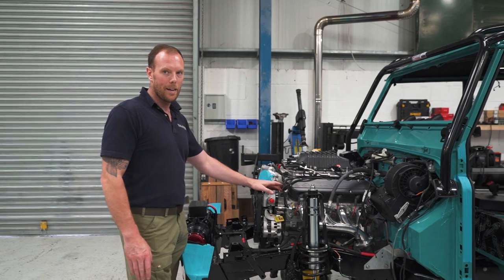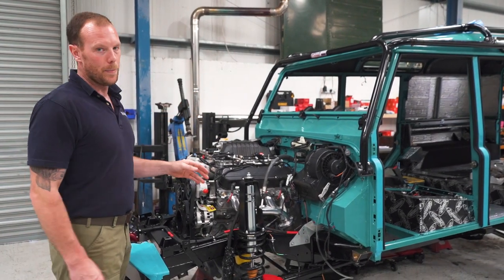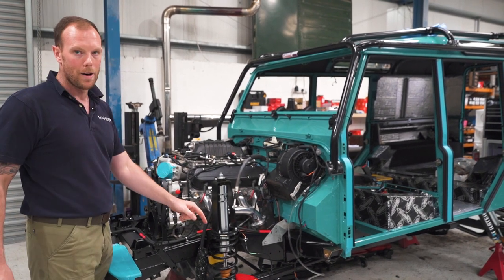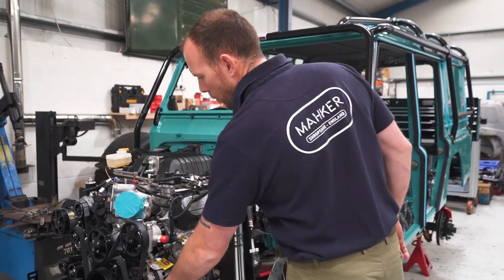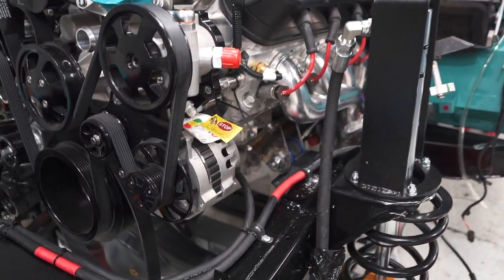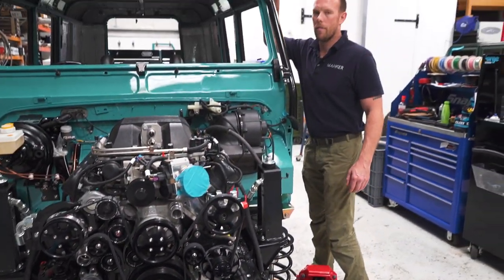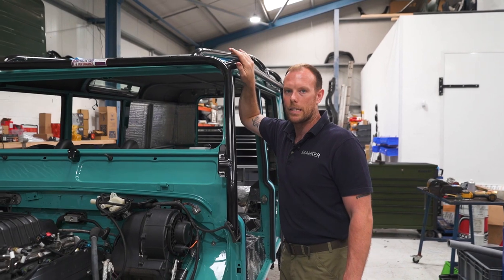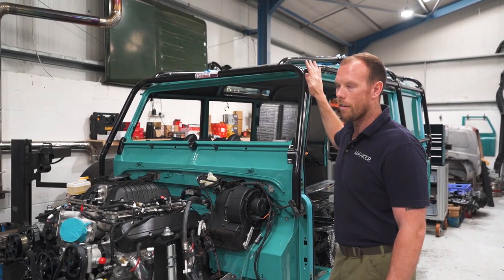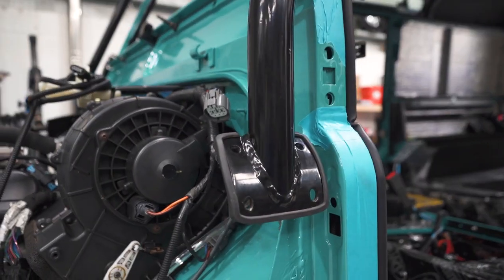Here's a catch-up of what we've been up to this last sweaty week in Wychurch, Shropshire. Project one: we've had about three guys on this solid for the last three weeks. The body's gone on, the chassis has been fully plumbed — brake lines, fuel lines, exhaust system fabricated, and the power feeds to the red Explorer 2 winch are all wired in. We've been fitting this beautiful roll cage from our friends at Protection and Performance, made from scratch in the UK. We're firm believers in supporting UK businesses — British made, British quality. It just fits with no need to jig or pull it into shape.